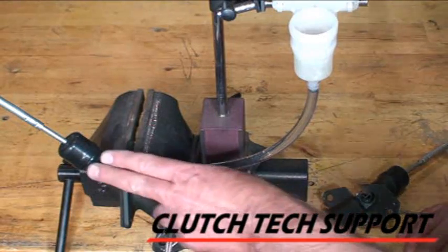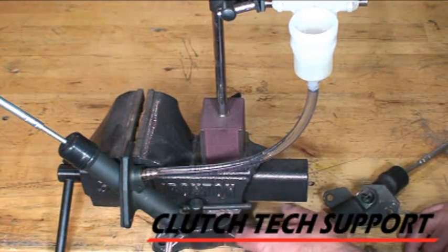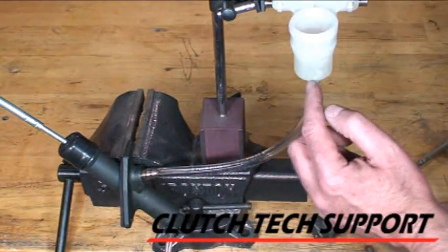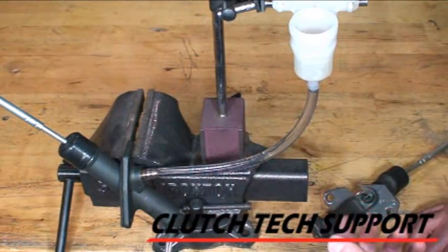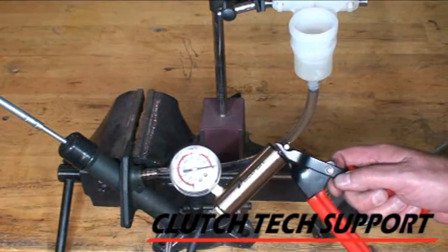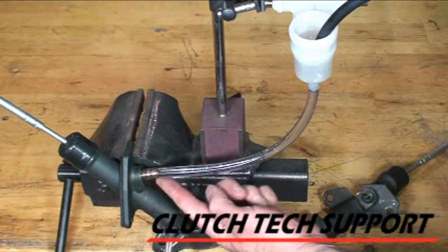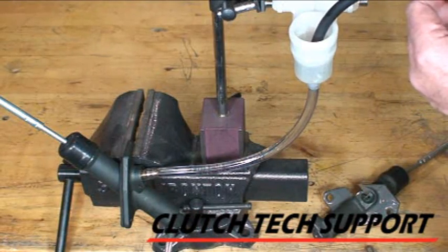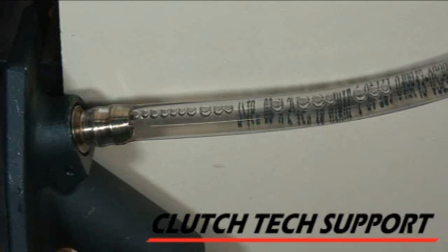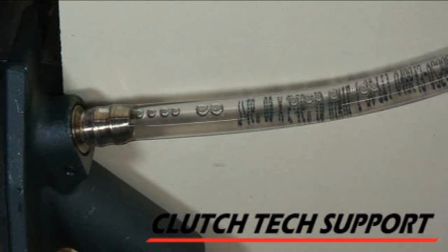Let's take a closer look at dry vacuum bleeding. I've got the same master cylinder setup with a line — not connected to a slave cylinder, but it does have a quick connect at the end, so it is terminated and closed. I replaced the black tubing with clear vinyl so we can see what's happening. We've got a reservoir, a catch bottle, a little adapter on the line, and a hand-operated vacuum pump. I'm going to insert the adapter in the reservoir at the port and apply vacuum — watch for bubbles. A little bit of vacuum, and we start to get a string of bubbles. That small transfer port for the pressure side seal is really small — the bubbles just can't flow through there all by themselves. That's about four inches of mercury, and it's still pulling bubbles through the system.